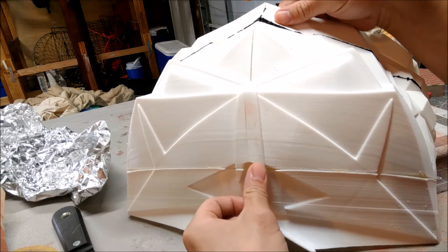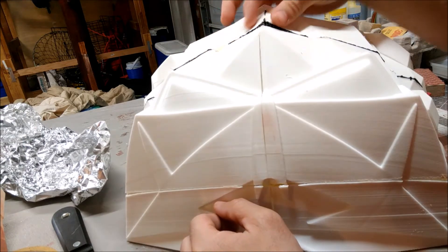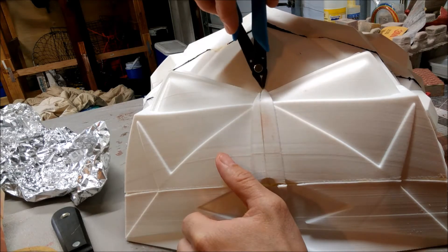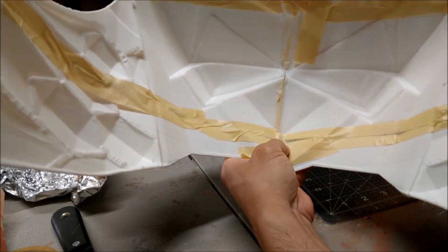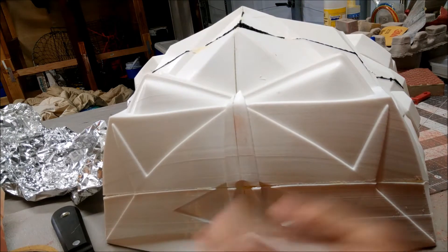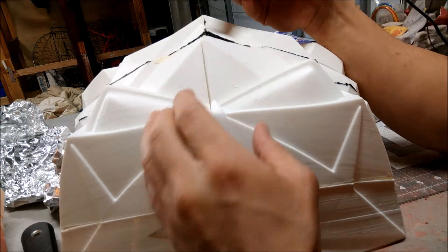The key here is we're basically just going to fill in the seam right here — it's a pretty big gap. We're just going to fill in this seam with plastic. What I've done before is I've overfilled it until it's spewing out and then just took cutters and clipped it flush. But what I'm going to do differently now is I have tape on the back side sealing it so the plastic doesn't spill out. I just want to fill in that seam all the way down.